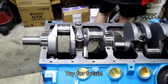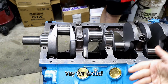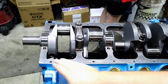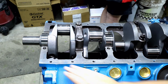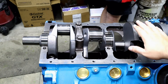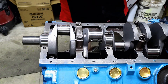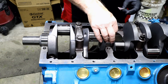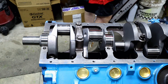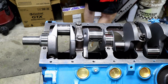Now it's time to go ahead and check our clearances with plastic gauge. The purpose of checking the clearances is to make sure that the right bed of oil is in between the bearings and the crank journals themselves. We've gone ahead and removed caps one and three, and removed the assembly lube. When we do this check, we're going to be really careful not to knock or move the crank because that will throw off the measurement. For this, we're going to use the red plastic gauge, not the green. Red is for American measurements — inches — and green is for metric. This is an American motor, so we measure in inches.